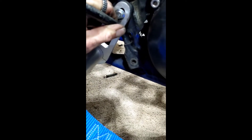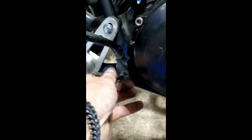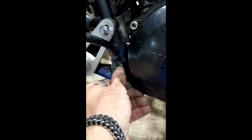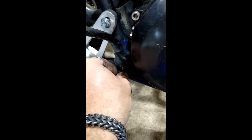Now, to see if this actually fits on here. Before you couldn't fit the bracket in because it was hitting the fender support. But now you'll see that it does actually line up. So it's just the installation of it as you're doing it — it makes it a little difficult when the fender strut or fender support is in place. I'll get this hand tight and then I'll grab my air ratchet and cinch this in quick.